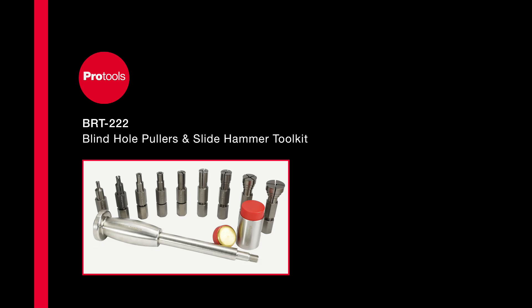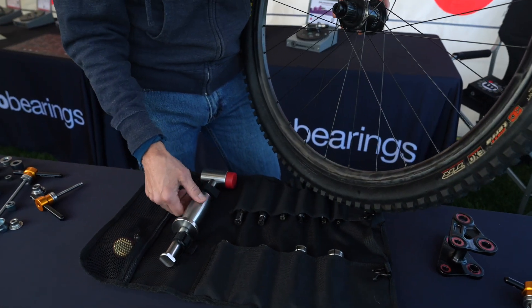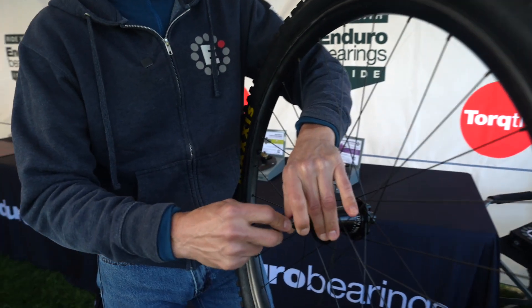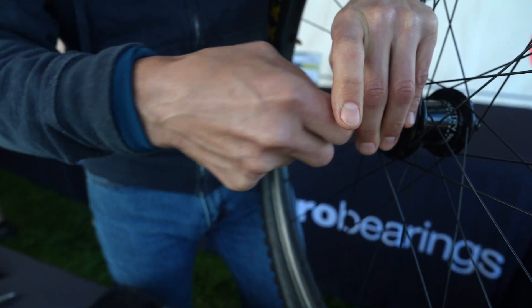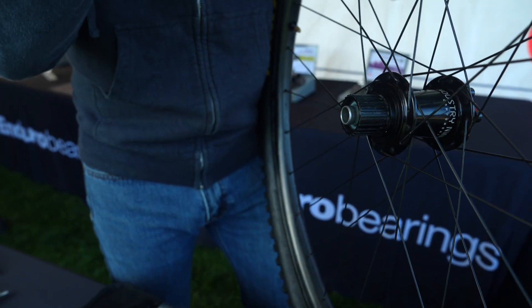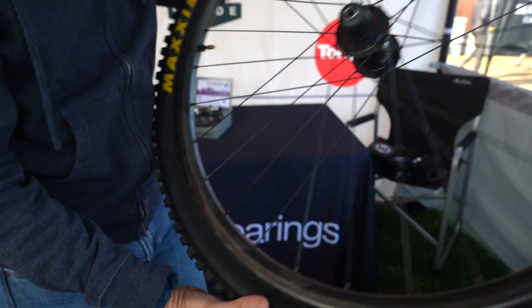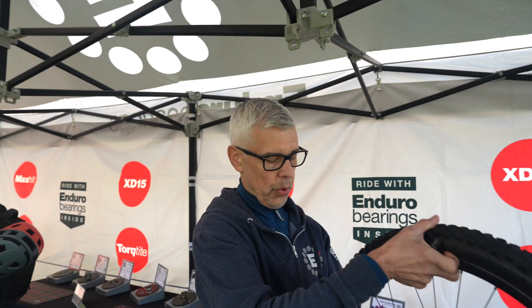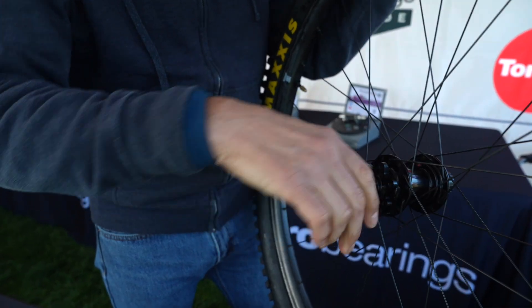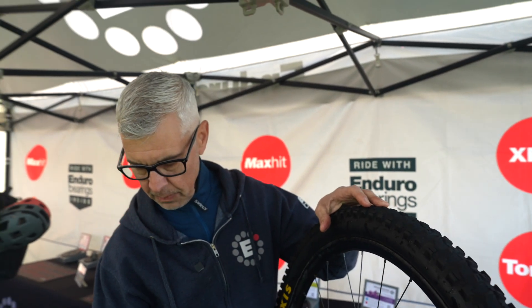I am using one of our tools here, which is our BRT222 — it's our high-end blind hole puller with a slide hammer. I'm just going to use this puller because it's a really convenient way of removing the axle end caps. You just loosen the puller, slide it in there until it notches, and you can just tighten it down with your fingers, then give it a little wiggle and it comes right out. Many repair manuals will show you, oh, take the axle, put it into a hub vise and pull up really hard on the wheel — not really necessary when you've got a little tool like this. It just makes the process so much simpler. So I'll pull out both of those end caps and set them aside for the time being.